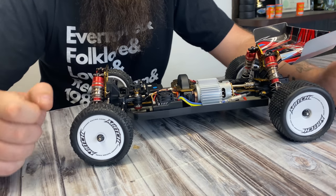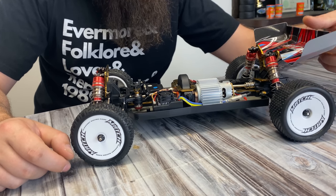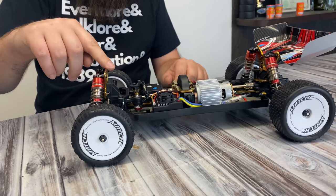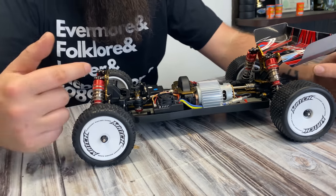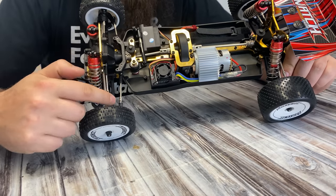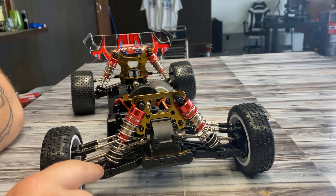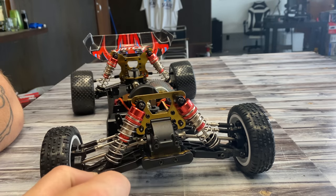And I think I'm going to do the same. Just a Lexan wing — Lexan wings are nice because they take a beating and go right back into place. We've got some pretty substantial oil-filled, fully adjustable, all-aluminum shocks, definitely a lot bigger than on the 14th and 12th scale versions. And all of your links are metal and adjustable. Awesome. So that's what it looks like under the hood. Let's tear this thing apart and see if it's holding any secrets. The first thing I'm going to do is take apart the shocks and see how much shock oil is actually in here and what the inside of them looks like.